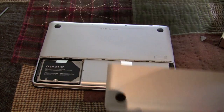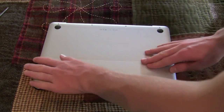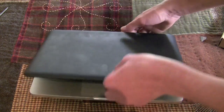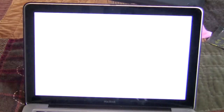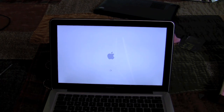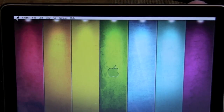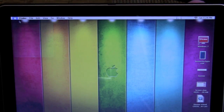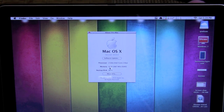You're going to need to take your lid, place it over where it should be, and then push down and it'll fall into place. Now we need to turn the MacBook over and power it on to see if the RAM did in fact register. RAM is a little bit finicky, and if you don't get it situated just right, your computer will not recognize it. On the splash screen, it will display to you how many gigabytes of RAM you have. And it does say four gigabytes, DDR3 SDRAM.